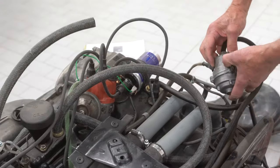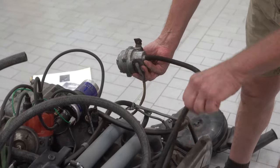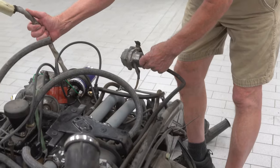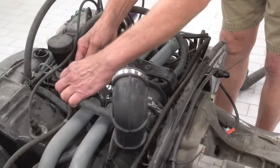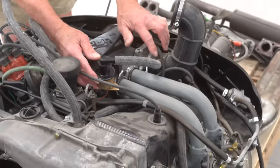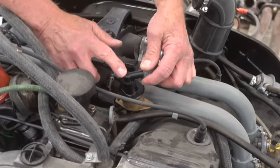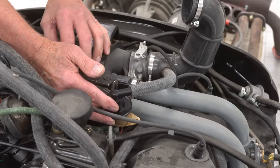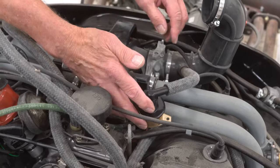The next one is the pressure sensor — this is the air pressure sensor which senses the vacuum, and it's actually mounted on the body and adjusts the duration of injection via the control unit. Then we have the auxiliary air valve. You can see it connects directly to the air intake boot and then directly to the plenum. This actually causes a vacuum leak when the car is cold to add more air, so that with more air and more fuel the mixture is richer, so it warms up easier and runs all right when it is cold.